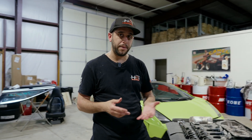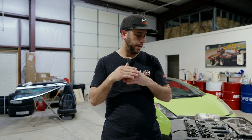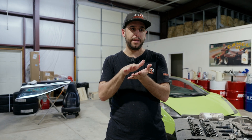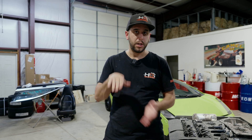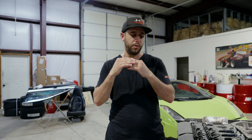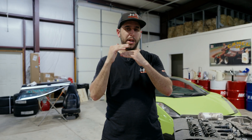What happens then is they measured it. There's kind of an unspoken level of how much you can grind off the cam lobe, and this one was right at 20 thousandths. What they're going to do is take a mold off the good lobe, then grind down the damaged lobe 20 thousandths. That 20 thousandths is not a big deal with hydraulic lifters because they're going to fill that 20 thousandths gap — it's going to be no big deal at all.